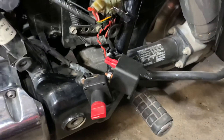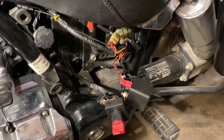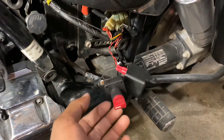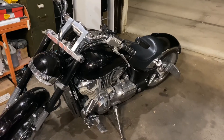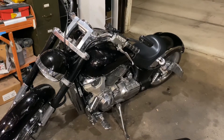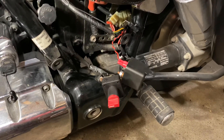One other reason I put it on this bike is because this bike is my long trip bike — where I'd go around the country — and when I get to a destination and leave it overnight, I will turn the switch off. Not that someone's gonna try to steal it, but even if they try, most people don't have a kill switch in their bike so they won't be able to start it. My normal driving bike is an identical bike and that one does not have a kill switch because it's my local riding bike — it's never gonna stay overnight anywhere. People can still push-start the bike, but electrical start would not work; it kills the starter basically.